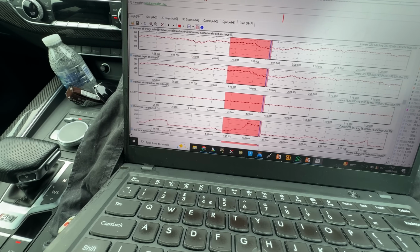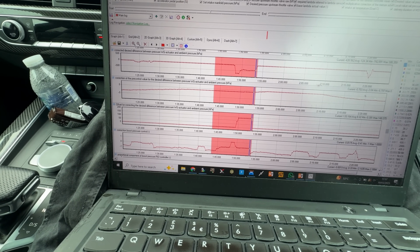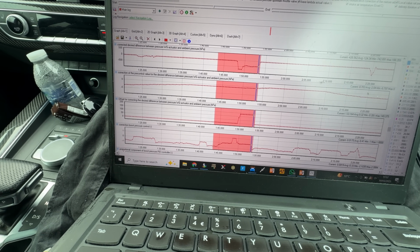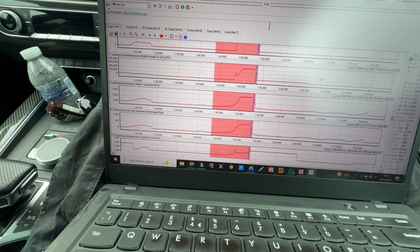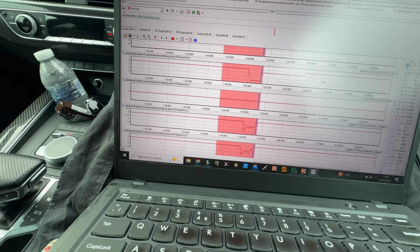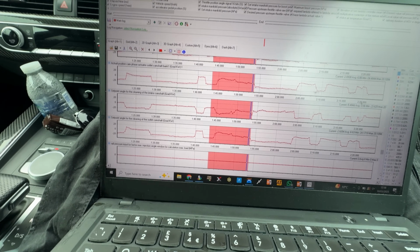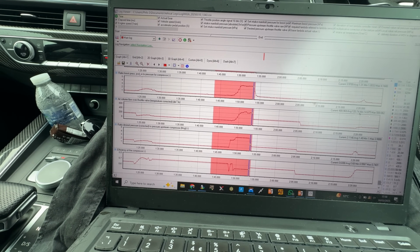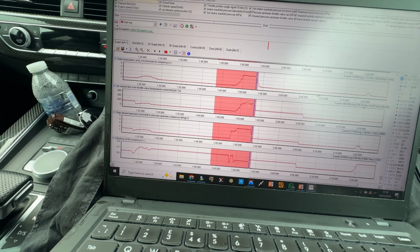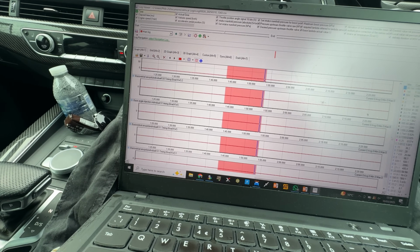Now these do have a relative pressure offset. It's the problem when you've got so many logs, you've got to sit and go through it all. Maximum target air charge, torque. Set at about 1.4 on a pressure ratio, which is quite high. Pressure upstream compressor, that's at 4. Ratio boost pressure, that's at 4. Got a bit of open on the air.